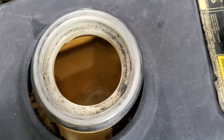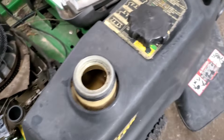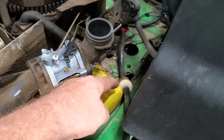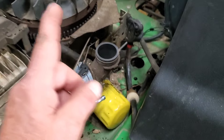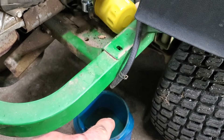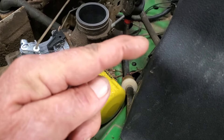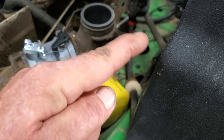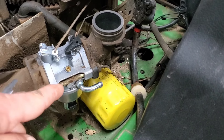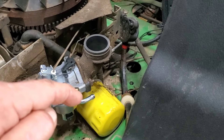Once you've got everything sucked out of the fuel tank, you're going to want to put some fresh gas in and replace the fuel cap gasket or the fuel cap. Then pull the fuel filter off before the carburetor, crank the engine over into a little container, and let it pump fresh gas through the lines. You don't want old gas in the fuel pump and fuel lines going into your brand new carburetor — you'll be taking that thing apart again if you don't clean it out first.